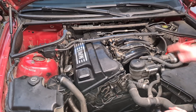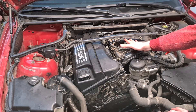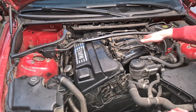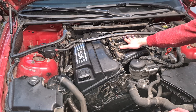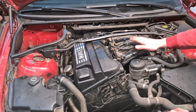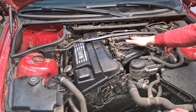Next step would be to put back the cover here, but sadly this car came without this cover — it is lost somewhere. When you are putting it back, just make sure that you engage the cover with the hole here and here at the back with the pins, so the back of the cover is nicely aligned. Otherwise this cover will be rubbing against the air filter or cabin filter housing and you will have noise and fine plastic dust all around this area.